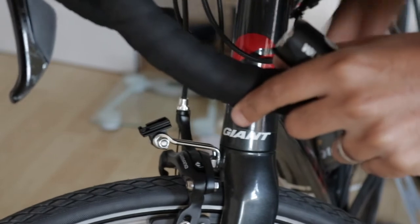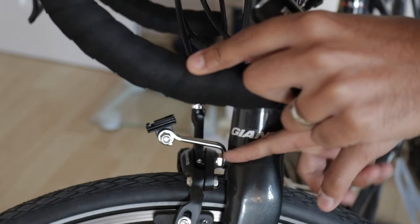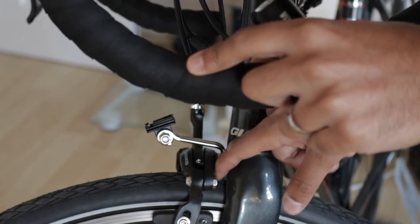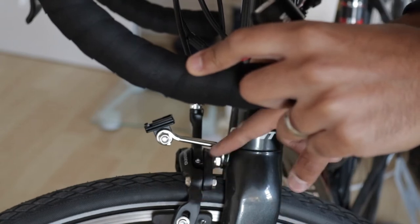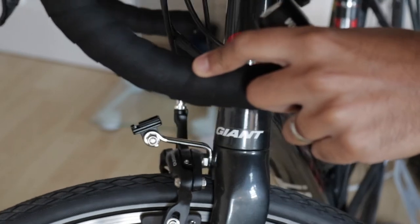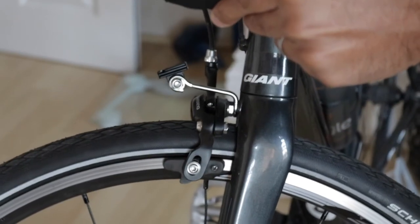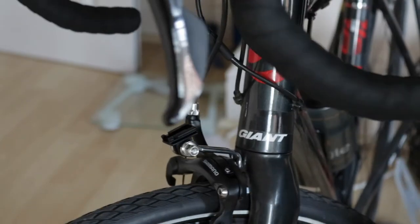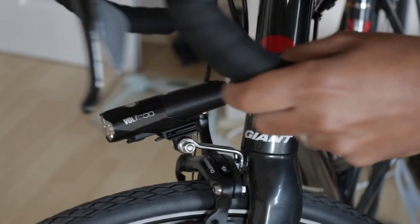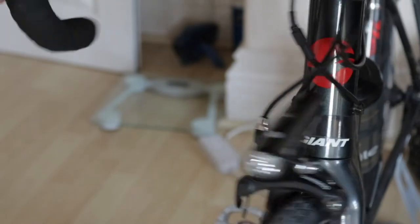If you can see that, it's just like a little band through there. You just undo your brakes — there was a spacer in there, I took that out — and then basically put this bar in. I had to just bend it up a little bit to move it away from the brakes. You can see there it doesn't hit, and then the light just clips on like that.